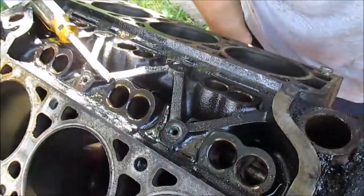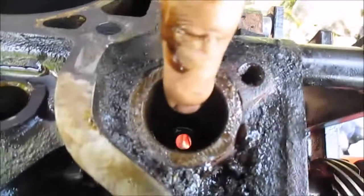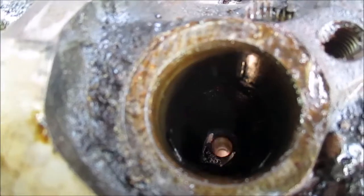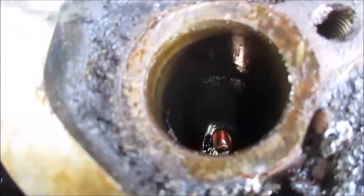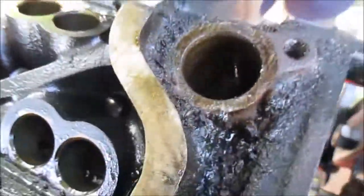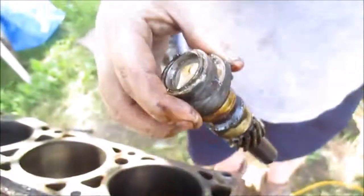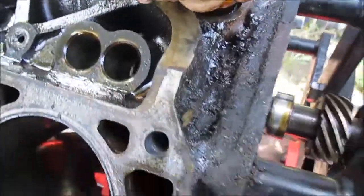Now that's the oil pump — you see that? Shine that light down in there. See right down there? Right there is the cap where the oil pump is. I pulled the shaft out. You just stick something up and you can drive this whole assembly out. You need to do that before you take the camshaft out.